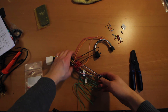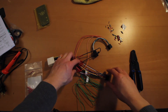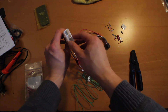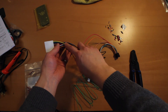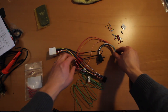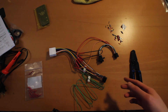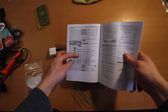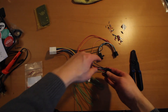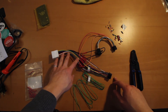Alright, so this is your wiring harness. I've gone ahead and already connected everything together using butt connectors. Basically, you have your 14-pin — this is the adapter from ae64.com, David Carter, he's the guy that makes these harnesses. You want to follow his instructions; he will email you all the instructions when you order through him. The only other thing you want to reference is your pin-out diagram for your aftermarket radio harness. For my situation, all of the colors on the aftermarket harness actually matched up with the wires that David uses, so that was really easy.